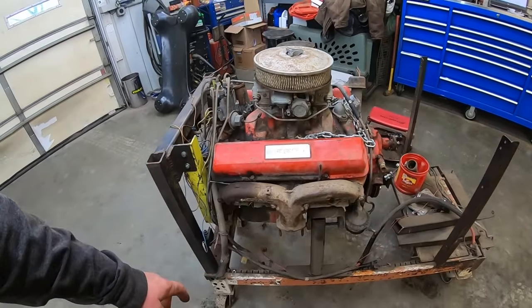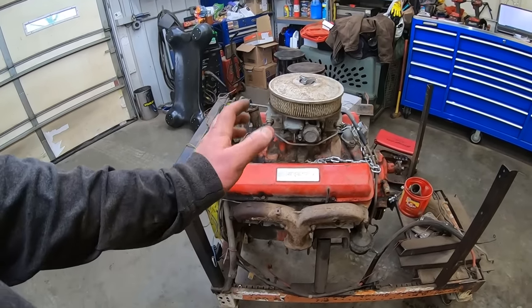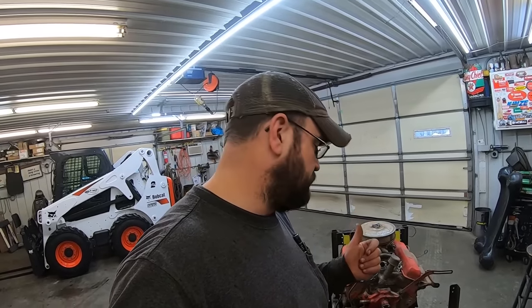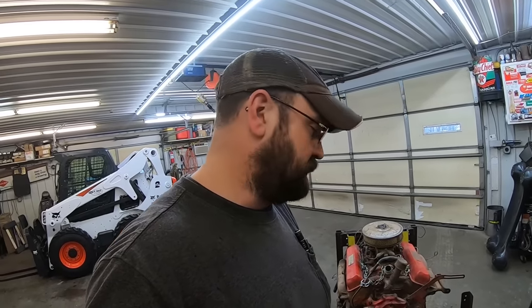So now I think we're probably just gonna pull some spark plugs out, maybe sneak a peek down the cylinders, put some oil in them, because A, this is not my engine, and B, this is not so much a rare engine, but a pretty good engine, you know, a 300 horse. Well, that's the other thing, those 62 to 65 castings could be anywhere from 250 horse all the way up to 375 horse. Use the same block, according to nastyz28.com. But yeah, because it's a pretty high horsepower engine, we're gonna take as good care of it as we can, and also since it's not ours. So, I'm gonna pop those plugs out, take a peek in there, see what's going on. I think he said he was turning it over regularly, but I know how that goes. You turn it over once every 8 years.